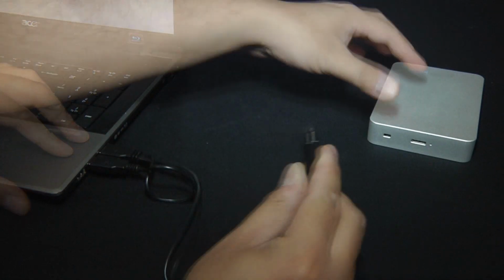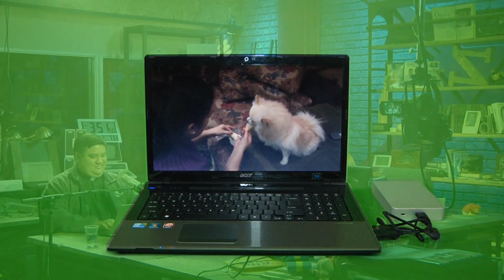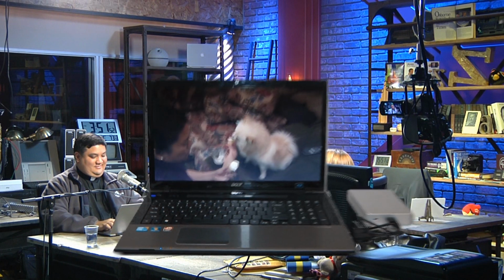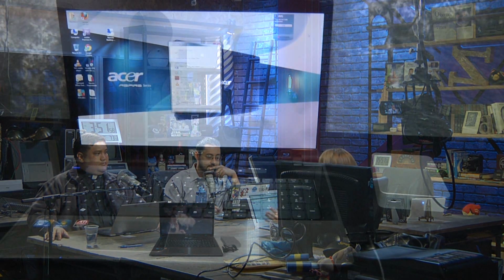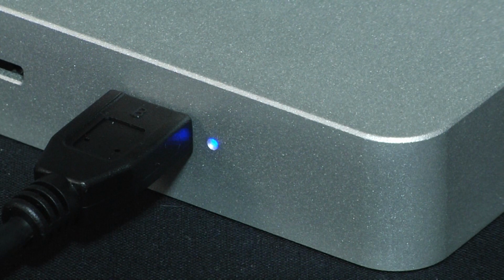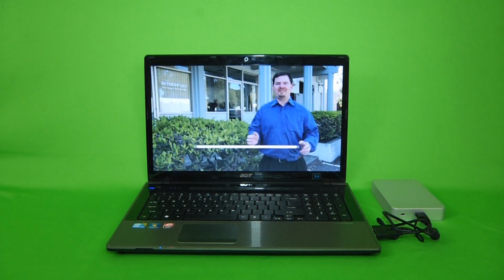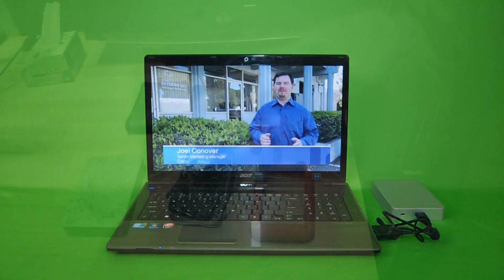The Rugged Portable's speed was about what you might expect from a mixed-mode drive. In our test using a USB 2.0 connection, it was able to maintain consistent write speeds of 27.8 megabytes per second and read speeds of up to 33 megabytes per second. In USB 3.0 mode, it scored 82.9 megabytes per second for writing and 106.2 megabytes per second in reading. These scores place the Rugged Portable in about the middle of the pack for I/O performance.